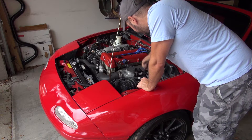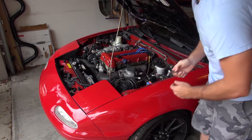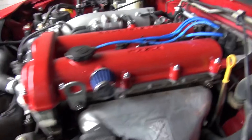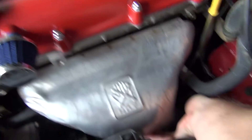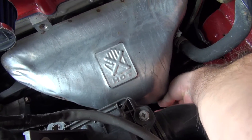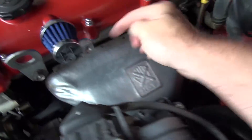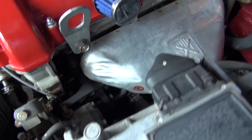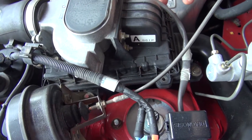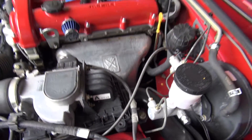If you've ever taken your heat shield off before, there's a bunch of stuff you have to do — it's not just as easy as taking out the four bolts. There's four bolts holding the heat shield on; I'm missing one of them. Unfortunately, to get it out you also have to remove the snorkel and loosen the air box, otherwise you're just not going to be able to get it out.